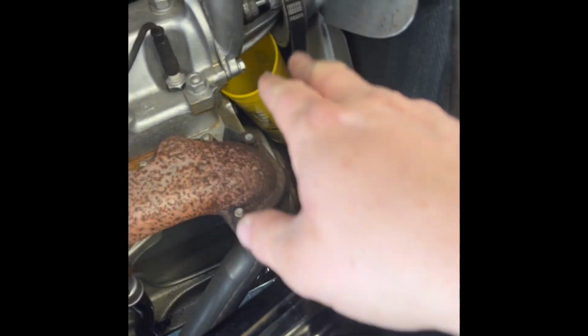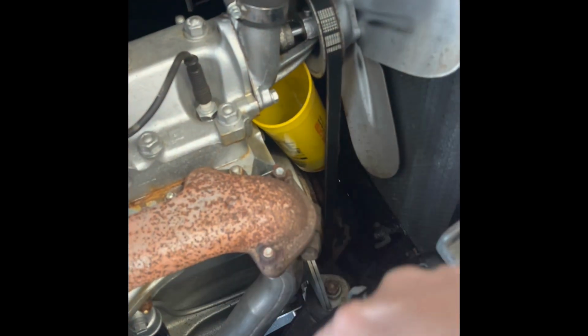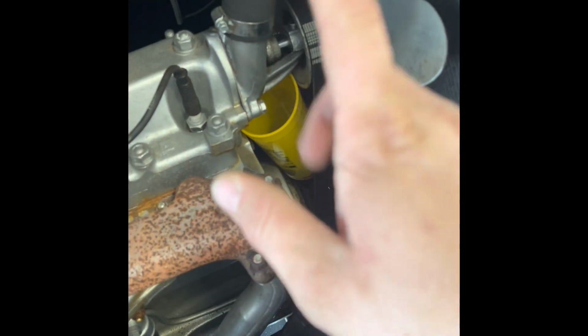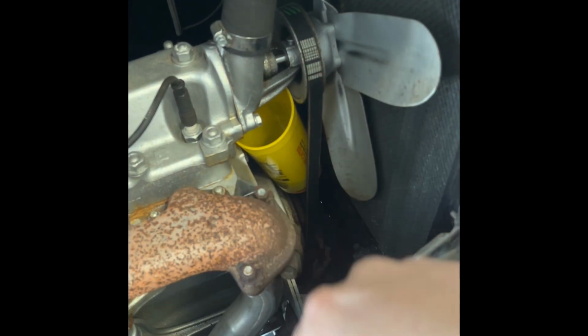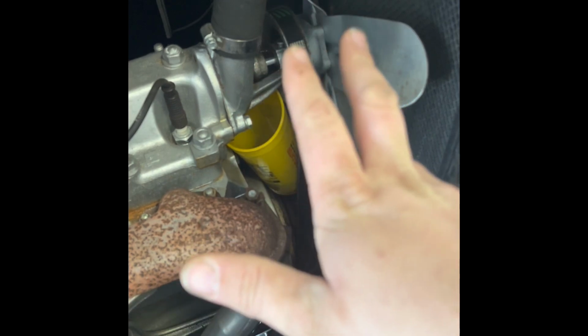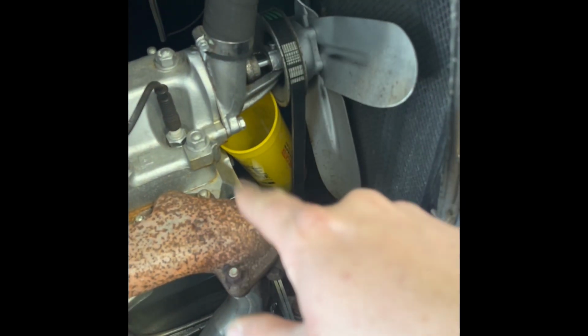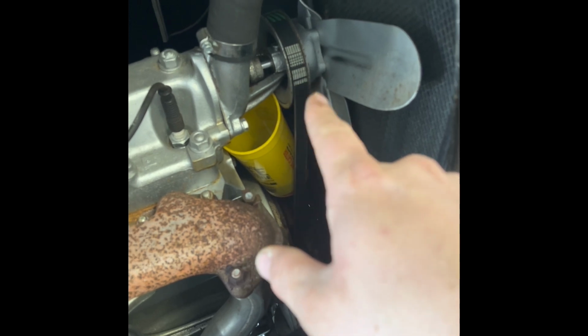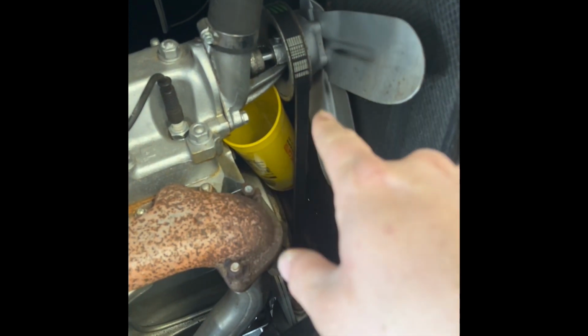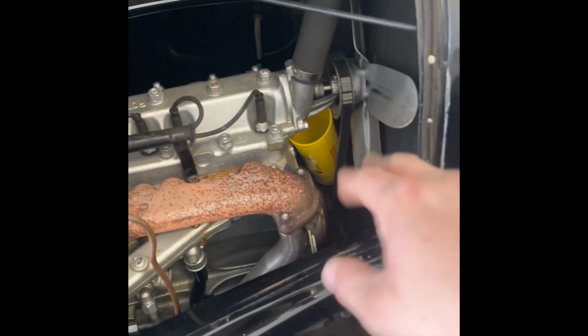I do have the correct packing in. I'm gonna change it. Well, maybe not change it. I'm gonna add a ring, see what happens. If that doesn't work, bye-bye. I'm buying an OEM, an original pump that's going to be rebuilt with a modern seal, and instead of this bronze bearing garbage, go with roller bearings with the grease zerk. Be done with it. Never have to mess with this stuff again. But I'll keep this one.